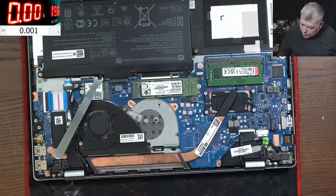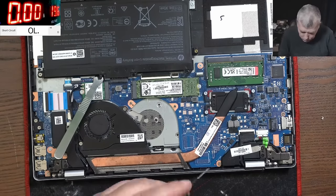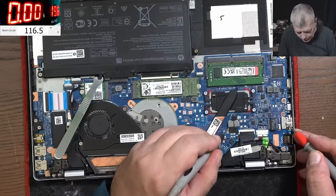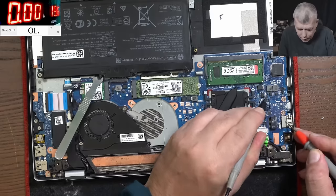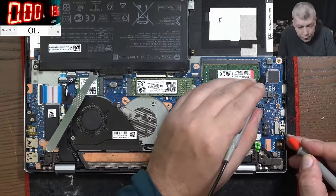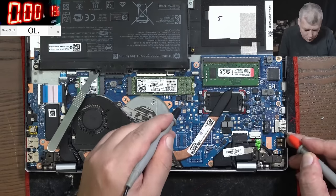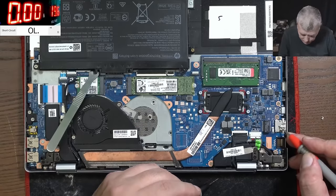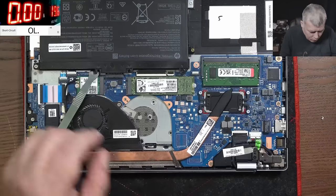Let's unplug the charger and check the coils a little bit here. CPU, 160 ohms. Probably here is 3.3 and 5 volts. Good. Probably here is 1.2, RAM memory. Good. I don't know what this is, but it's good. So it's looking fine. So what's the problem?